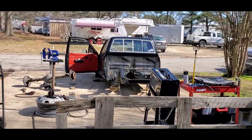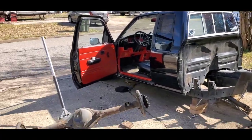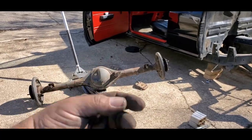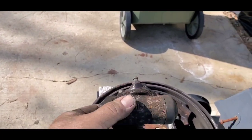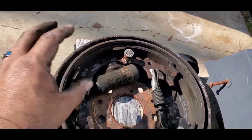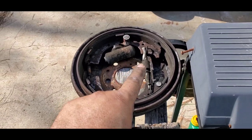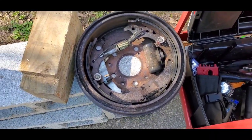What happened here? A little bit of movie magic. Had to take the actual part — so I took the brake lines off. I've got a brake bleeder so I can re-bleed all the brakes. Some of you might not have that opportunity, so you'll have to actually pump the brakes and bleed them all back through. Taking these apart, the drum brakes are just freaking nasty. Brake slave cylinders — these have to be rebuilt because on one of them they're leaking right there. Eventually that's going to blow out. They do make rebuild kits for these and it's very simple. I'm not going to explain how I took the drum brakes apart because if you've never dealt with drum brakes, you might not want to start. Do a lot of research on these because they are a pain in the ass. The other side is exactly the same — it is just a pile of crap in there and they need to be redone.